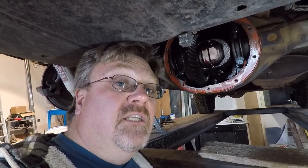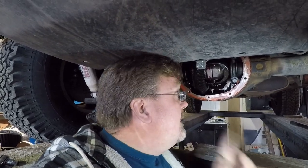One thing: the manual says you should be able to turn the tire and see it lock and unlock. I don't have the tires on because I had to remove the calipers to slide the axles in and out. I tried turning the rotors and it didn't unlock at all — I don't know if that's wear on the unit. Everything looks to be installed properly; it could just be I don't have a tire on there to give me more leverage. So I went ahead and put the brakes and wheels on to check again before putting the cover on, and now everything works just like it should. The problem was you need the lever of the tires to turn it.